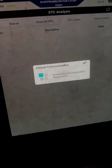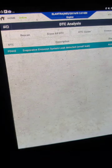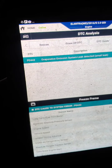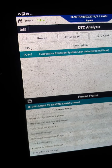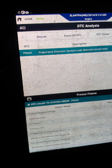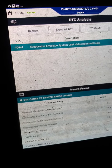Let's see if there's an available freeze frame and check that. Usually if I have this kind of code I check if I have commands for my canister close valve. If it's a canister close valve problem — like stuck open — I'd expect a large leak, but let's double-check all our components in the EVAP system and see what happened.